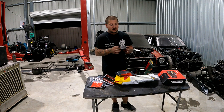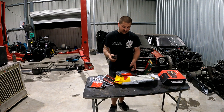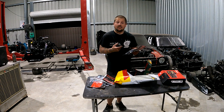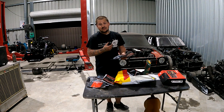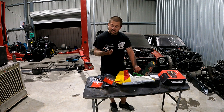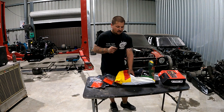We also have the wideband nano. This displays so much easier to read externally — big digital letters showing what it's running, very bright. It all runs off CAN so it's literally only a couple of wires. It does need external power and earth, then communicates through just two wires via CAN. We're running this on the jet boat and it does a great job. It comes with the O2 sensor as well — wideband all in one, and the FuelTech ECU takes control of everything else.